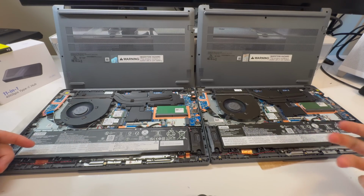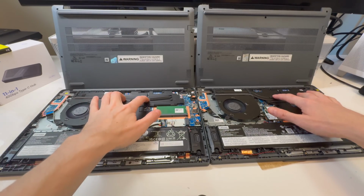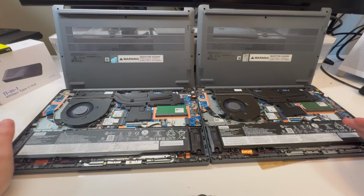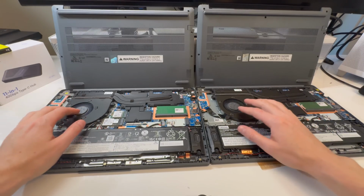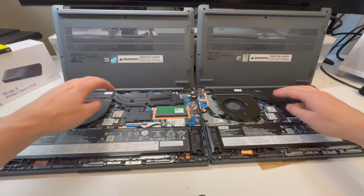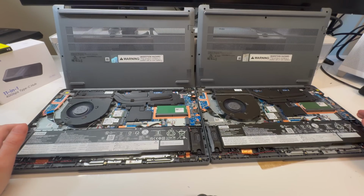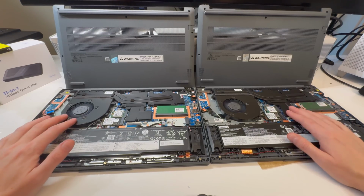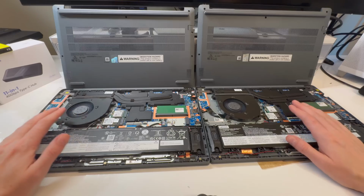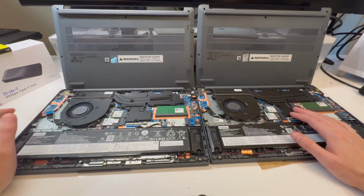Again, it is an RTX system. You're going to have 12th gen Intel, which doesn't run super cool, to be honest, at HX, and then you're going to have RTX as well. So you actually have 2 chips down there being cooled by one single fan. Fortunately, it's a giant fan, huge giant fan, and it's kind of the Lenovo style where they don't have as much noise turbulence, and 2 thick heat pipes on there, lots of VRM coverage. And spoiler again for the rest of the video, they are fairly low wattage offerings. So the CPUs actually only can get up to 70 watts under full load when only the CPU is being used. The GPUs are not going to be full wattage, 120 watt or 115 watt, 3050 for example.